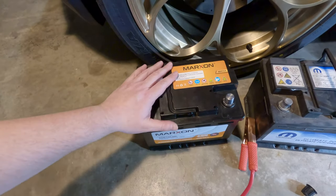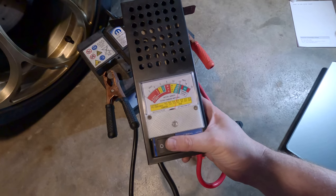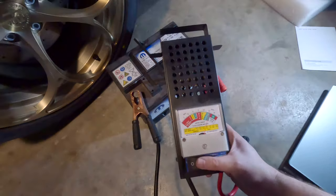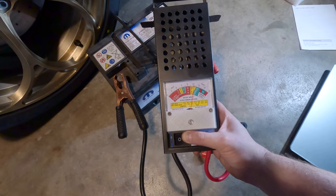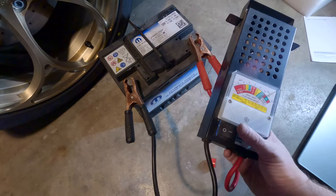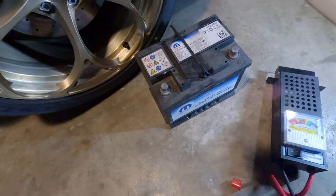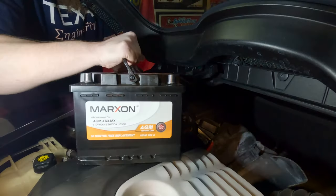Let's check the old battery. It's already showing weak — only at 12 volts. Hit the tester and... it's showing like a 400 CCA battery. I'm kind of surprised, but the battery is nine years old, so what do you expect? Still damn impressive — good job Mopar.